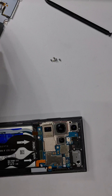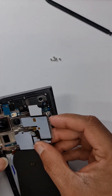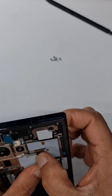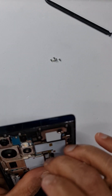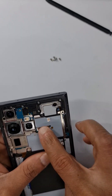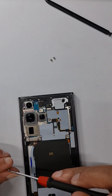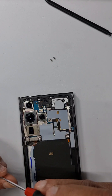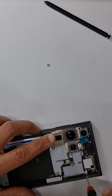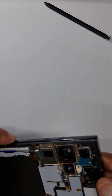Once that's sorted, connect the last bit — the NFC antenna and the wireless charging flex pad. Connect this flex, press it down, make sure it's aligned, and give it a nice press down. Then put all the screws back. We need to put new adhesive on the back glass to maintain the phone's water resistance. I've ordered genuine adhesive for this phone and will install it now.